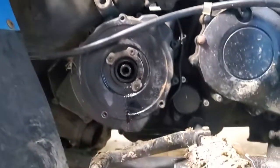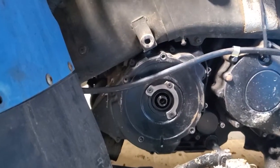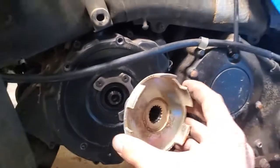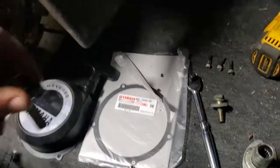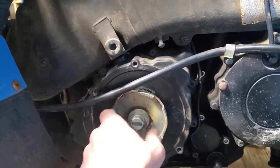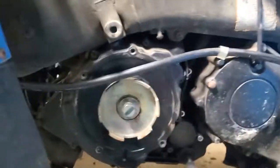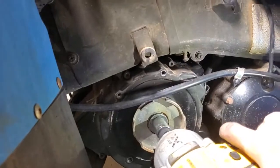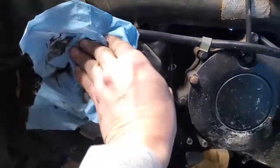Let's clean it up and make sure there wasn't any dirt causing the failure, and then we'll install the new one. We'll have to replace that seal another time, but no problem since it takes two seconds to get it off. Clean up that mating surface, clean up this mating surface. Wow, perfect — easy. Now let's use our bolt. I don't have a torque spec for this, but we're just gonna do about 20 pounds — a good snug torque.